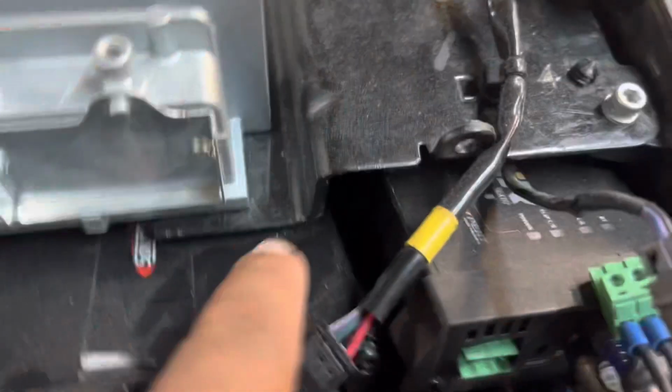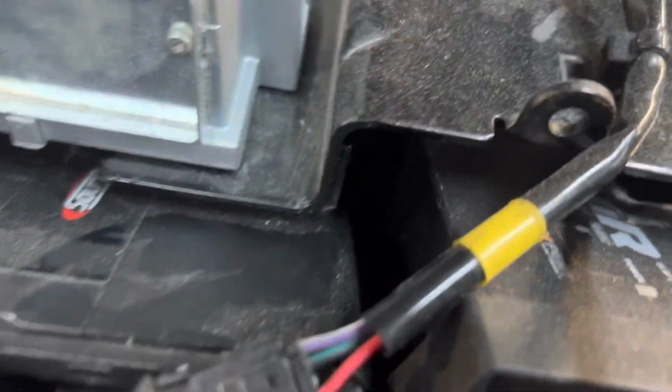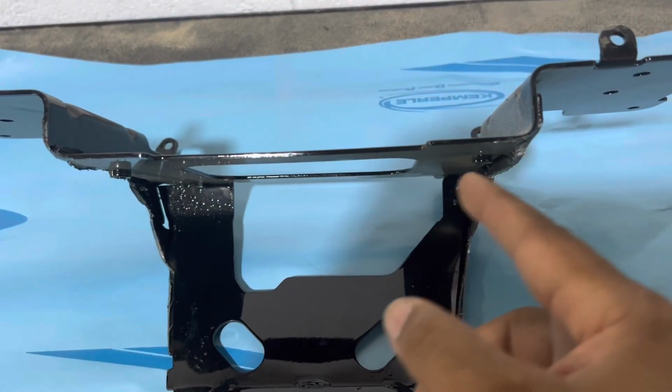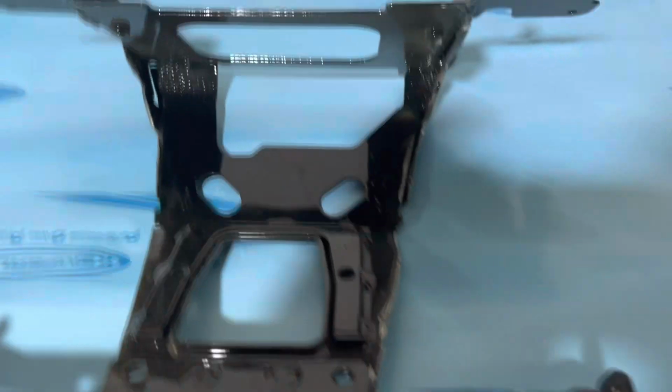The back tapers back, so it gets bigger in the back. That's no big deal. But right here is the crucial part. You have to make sure that is flat. So if you grind those two corners nice and flat, you have plenty of room and your headlight goes in, no problem. That's the way it should look when it's cut. Nothing hanging over here. Nothing hanging over here.